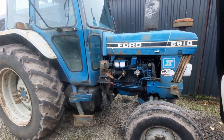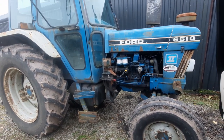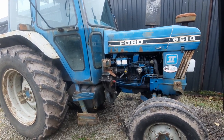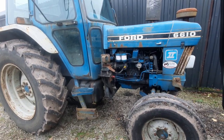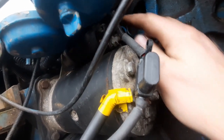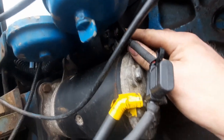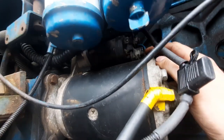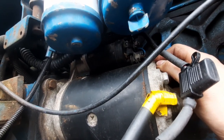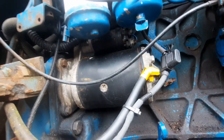This thing has been having a problem for some time and I need to get it started today because I need it urgently — I've got some work to do with it. It's been neglected long enough, better tackle the problem. Up here is the main issue: that connection on the solenoid just continuously frying. Even if it does crank over I get a strong smell of burning and it's actually melted part of the casing, so I'm going to pull the starter and have a look at it.